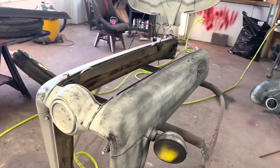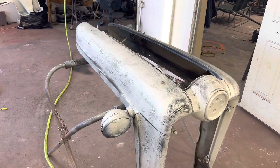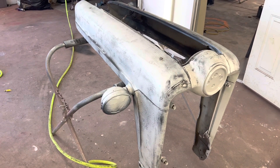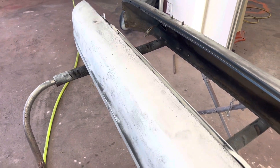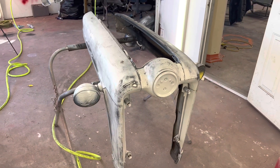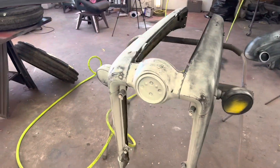Yesterday we started to put some paint over that encapsulator, and I neglected the dry time — it's actually six to eight hours, and I just thought it was an hour like other epoxy primers. So when we did that, our enamel started to kind of react with it and bubble just a little bit. We hit the brakes and stopped, let our enamel dry, came back out today, went over that with a DA sander and some 320, and got her smooth back out. Now we're ready to go ahead and continue.